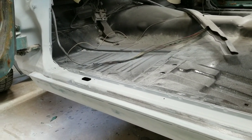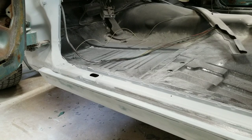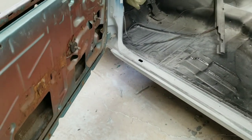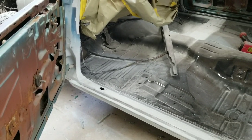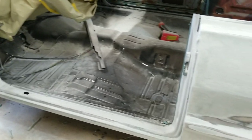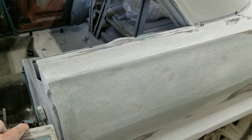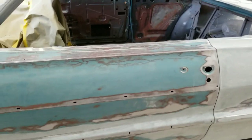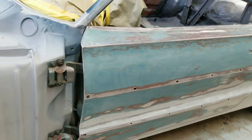This is basically how the pros do it on these cars — you want these gaps perfect and this is really the only way you can get them. They're not perfect from the factory when you do quarters; the quarters you get are never perfect. When they stamp the quarters out, they're allowed like a 16th or something tolerance they can be off. So gaps and lines hardly ever line up, but this is how it's done.